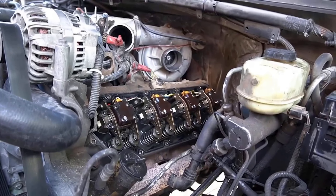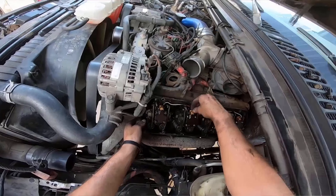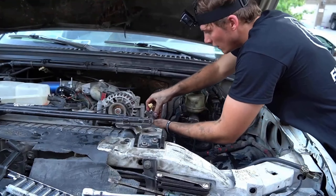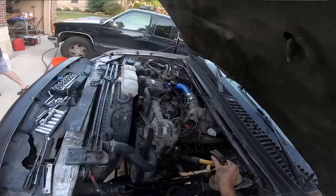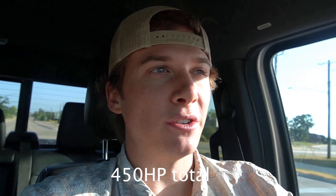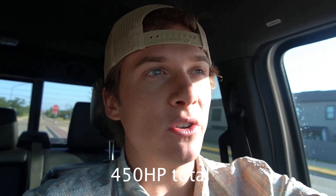The next mod is going to be injectors. The 7.3 is definitely one of the cheapest trucks to mod out because all the parts are so cheap. New injectors are going to run you about $1,300, versus on a 6.0 or a 6.7 where new injectors would run you easily two to three grand. I would recommend the 180x30cc injectors on the 7.3 — that's what I put on my truck. I got about 100 to 200 horsepower with those, and with custom tuning I got about another 100 horsepower, so about 200 to 250 horsepower just from the injectors and tune combined.